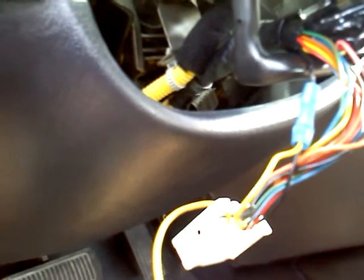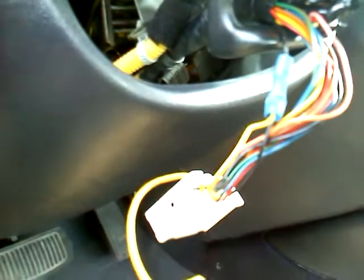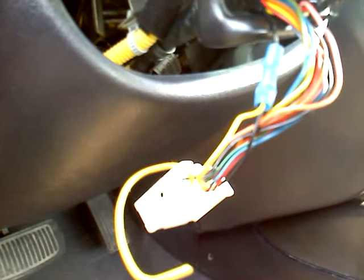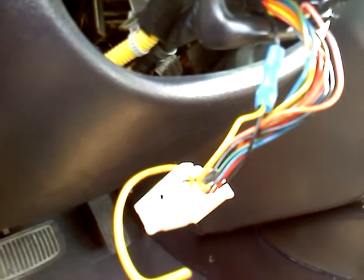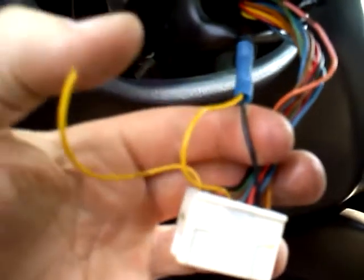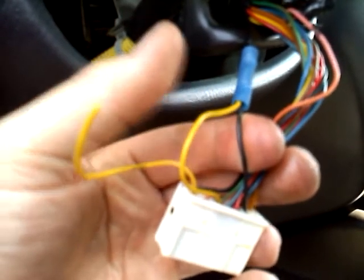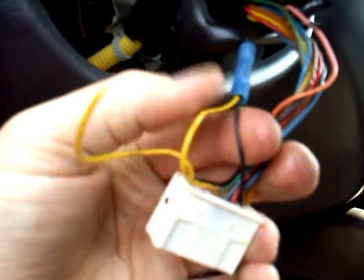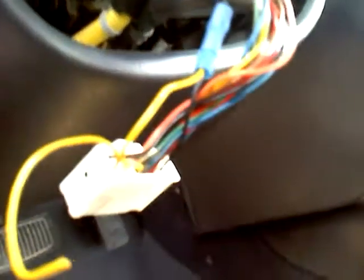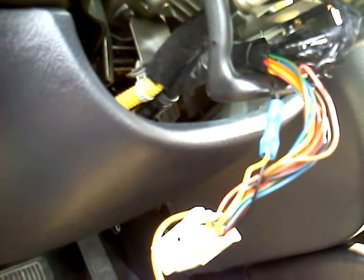I could go further and have them independent at all times with no power going to the switch, but I don't feel it's necessary. This is good enough — at least I can drive around when it's dusk out and throw my fog lights on with the city lights. To recap: cut this wire, these two yellow wires are looped together, cut them in half, and connect them to the black ground wire, and you're good to go. That is literally all you have to do — you can run parking lights and fog lights at any time you want.